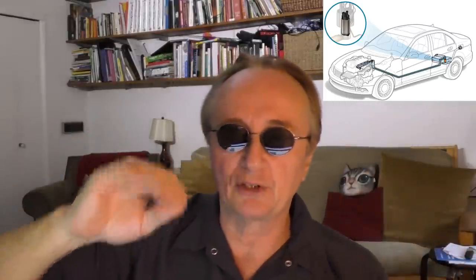Toyota_Honda_1999 says: I've got a 99 Civic 5-speed with 145,000 miles — when I shut it off it makes a weird noise every few minutes for about 20 minutes, quiet but noticeable. I want to hear that noise so post a video. If it's little clackly noises, that's the exhaust system — as it cools down it makes clacking noises. If it's not that, try opening the gas cap and listening inside the filler neck; if you hear it in there it's the fuel pump turning itself on and off, which could mean a bad fuel pump relay or a bad ignition switch still sending power to the pump. Make a video so I can listen.